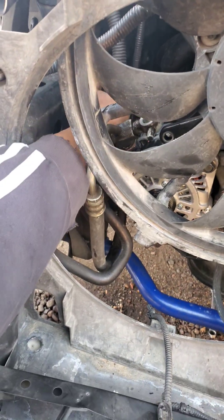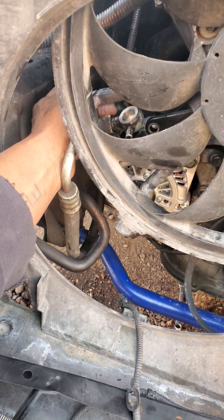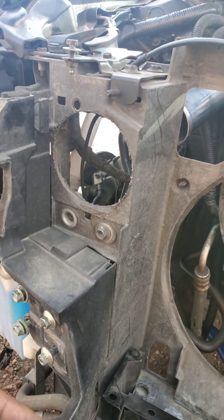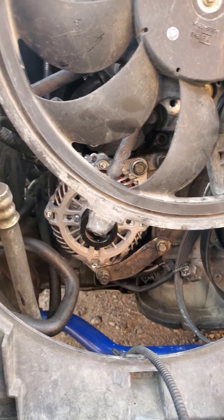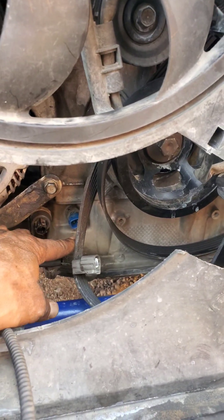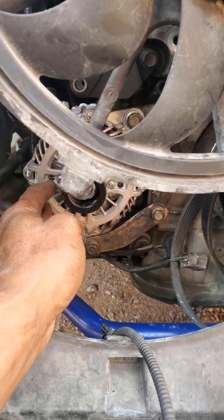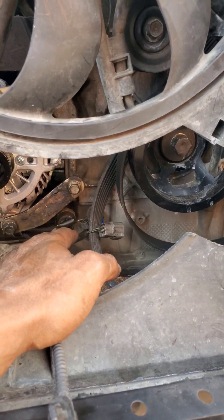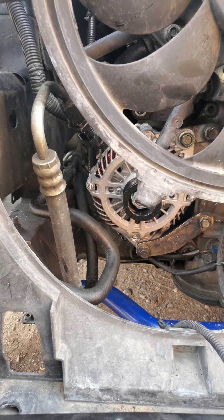This is the wire that goes to the back of your alternator. I can zip tie it right here so it's more sturdy, but I don't need that bracket to keep it straight. First things first — I took that bracket out, that's gonna make your job easier. I also took these two plugs down there out, and that makes your job easier too. First I put the alternator in, then I put this bracket in. That bracket in the back we don't even need.